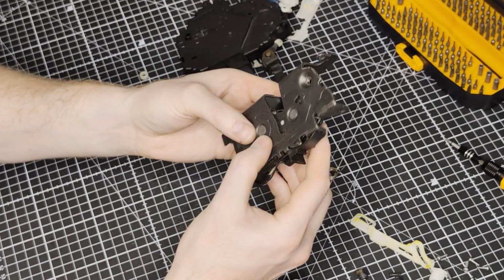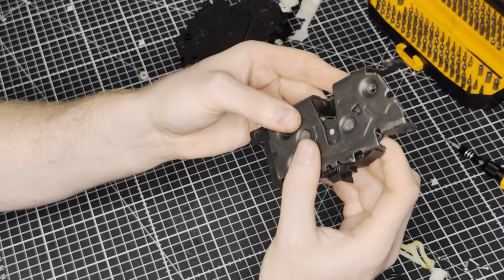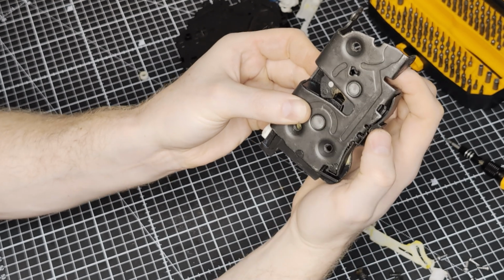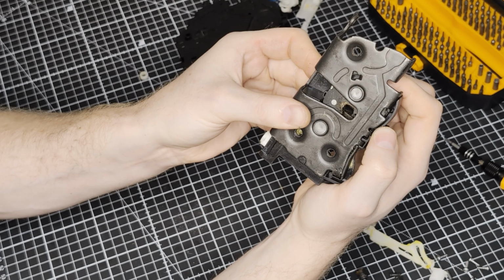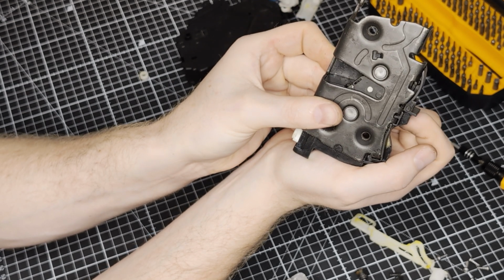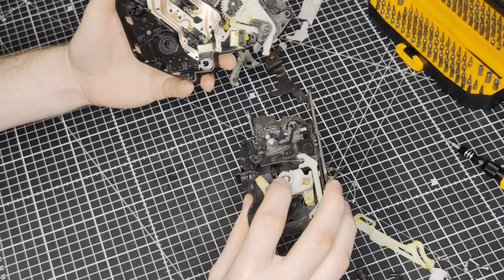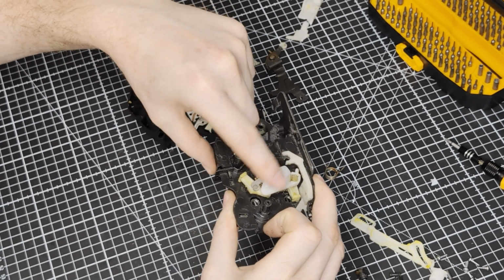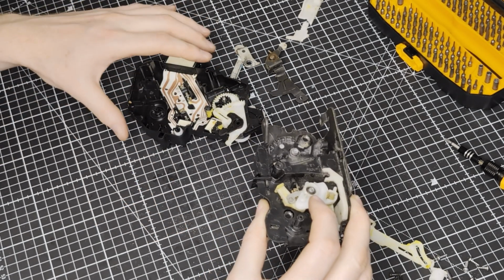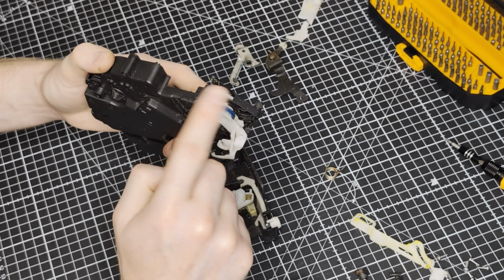One thing I have just realised is this is the part that actually locks the door. So you'd have your door pin would lock into that. And then there's a secondary lock, and then it releases and the door pops open. There's clearly a few little mechanisms. So there's the lock, there's the spring mechanism type thing that resets the ratchet. That is activated by probably something on here because this is where the motor is, so there's going to be some kind of connection.